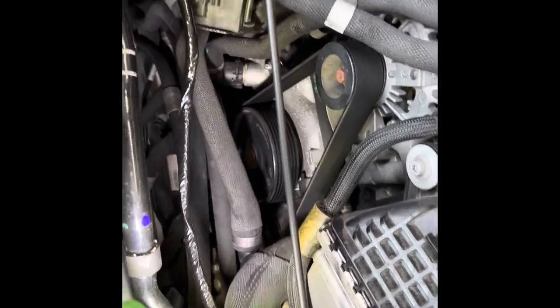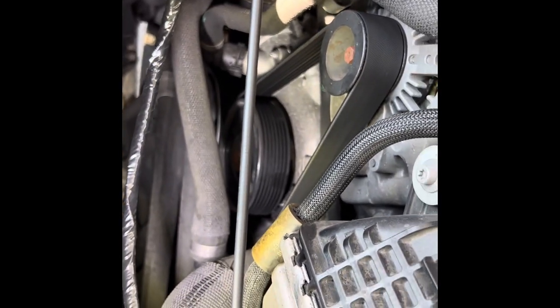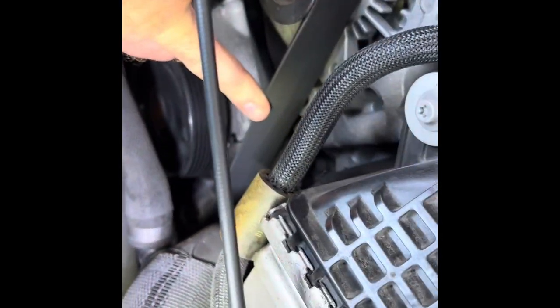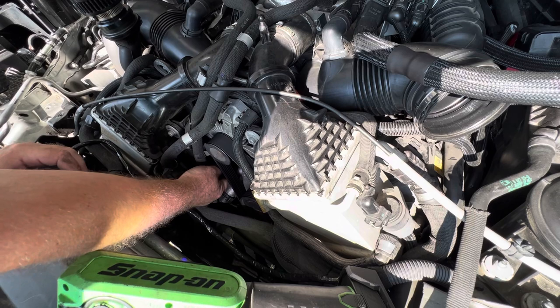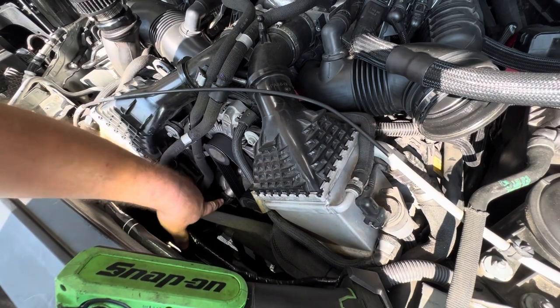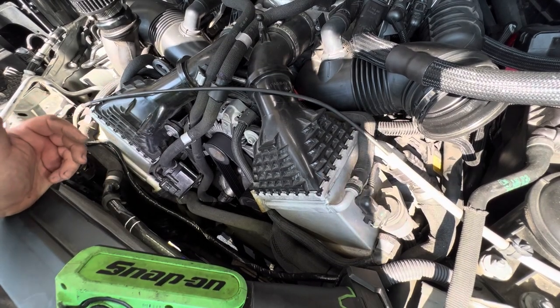I checked the bottom of the radiator and I do not see a drain plug — I dropped the belly pan and don't see anything. So at this point we're going to loosen this hose that goes to one of the turbo cooling lines, and we're going to loosen this sensor. For the sensor, just press that metal tab and it will pretty much release. The connector is now loose. On this hose it's a basic metal clip — just lift up and it should slide right off, so I'm going to grab a pan.